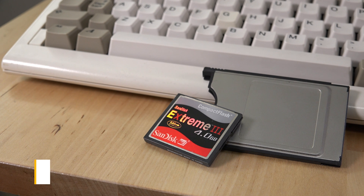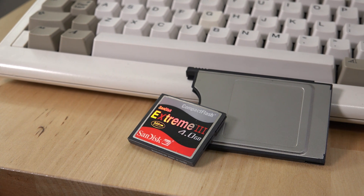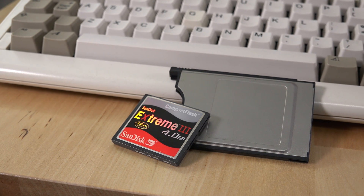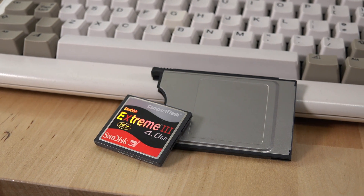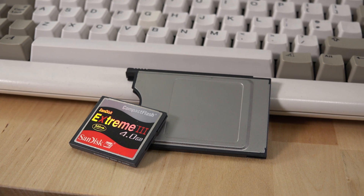What's going on guys, Todd here. If you've watched any of my previous Amiga videos, you'll know my general dislike for compact flash media. They've gotten expensive and difficult to find, plus sometimes compatibility with our Amiga computers is spotty at best. Some cards work on the IDE controller whilst the same card will not work in a PCMCIA adapter — basically it comes down to trial and error.